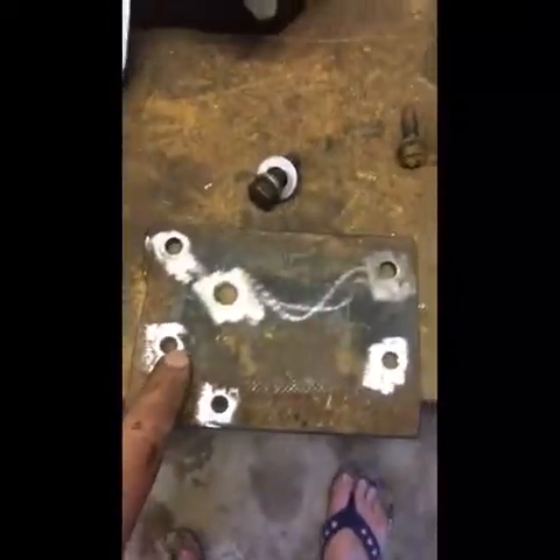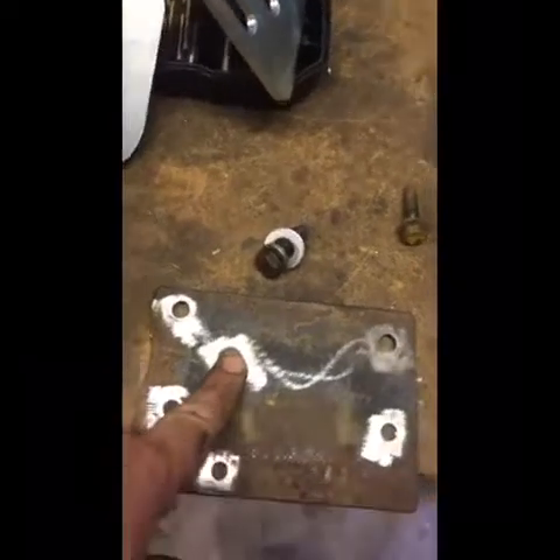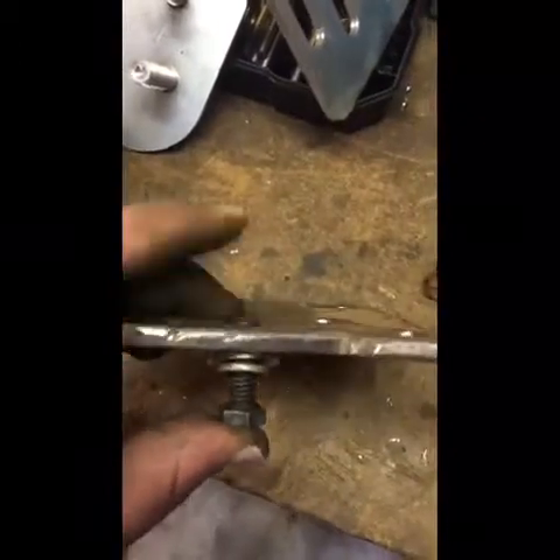So I made my own plate. It's kind of ugly, but I drilled these holes — this hole's kind of big because it wasn't quite centered. This is where it bolts to the body right here up top in the wheel well, and then here is where the bracket bolts in. I drilled those and tapped those. The reason why I tapped them is because there's not enough room to put a nut on the back side — it's too close to the body.